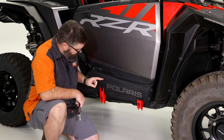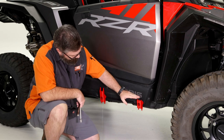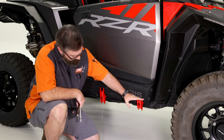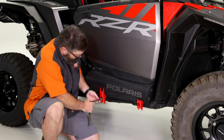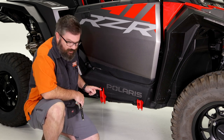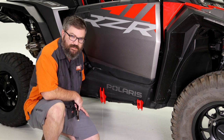Okay, last thing to note is the orientation of these. So on the front mount, we've got the flat top cut here. That tells you that the right side is up. And on the back, your hardware is down in this low position and you've got the tubing cutouts at the top. Okay, now we're ready to grab the rail and we can do the final install on this.